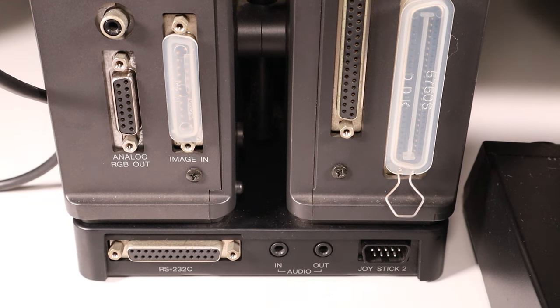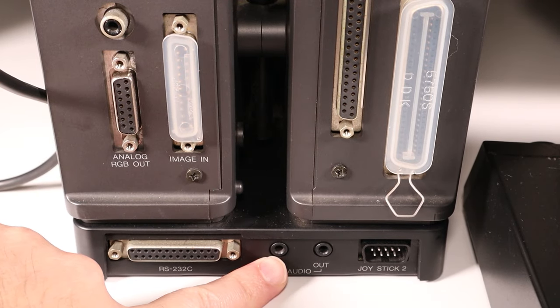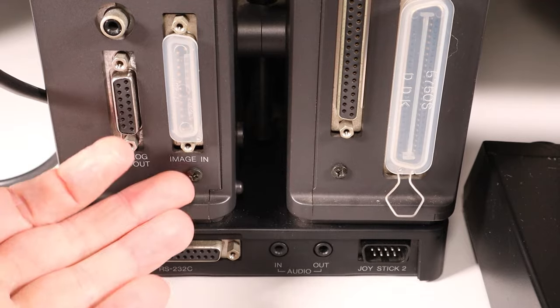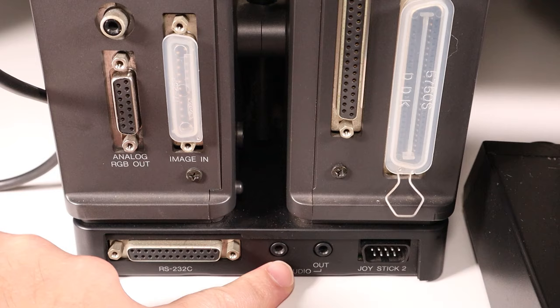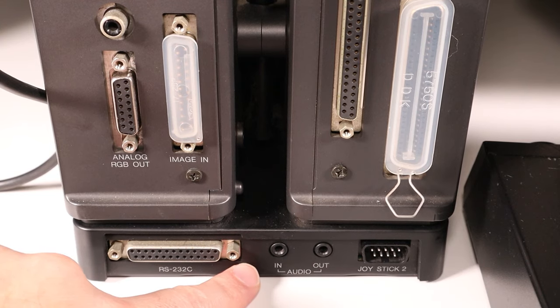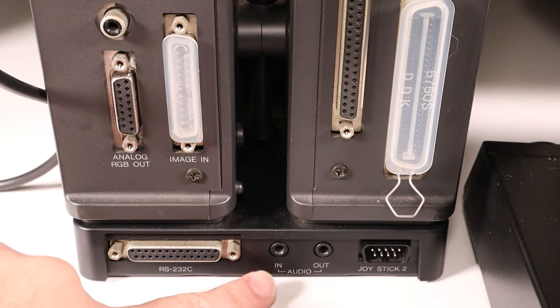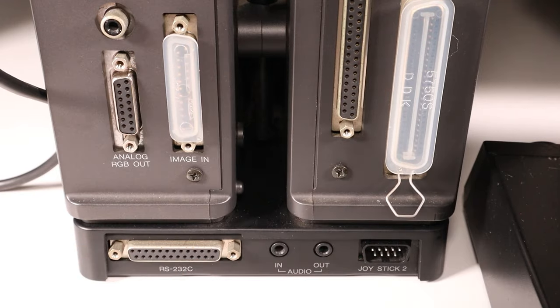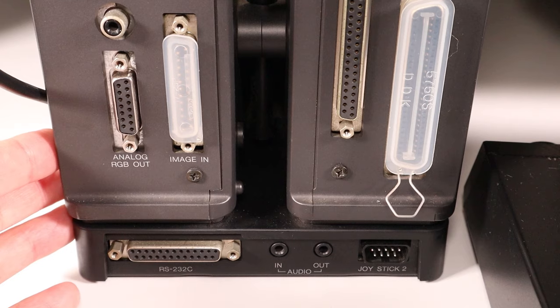You may remember from past episodes that the X68000 has a video input as well as an audio input. Now, this is mostly for genlocking, overlaying computer graphics on top of an external source. The audio input passes the source into the digital PCM chip of the system and allows you to digitize samples. It is not, unfortunately, used for passing through audio from an external source or mixing it with the computer's internal sound and then passing it out the output.